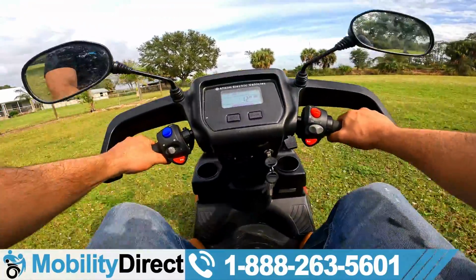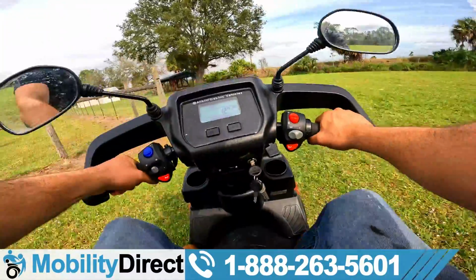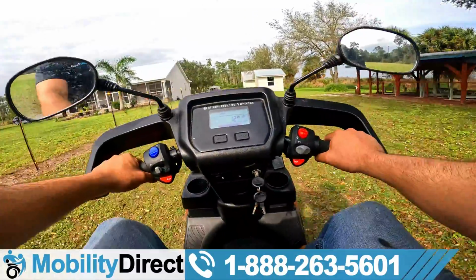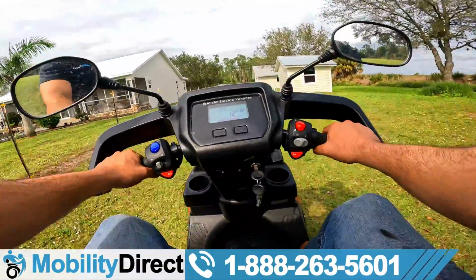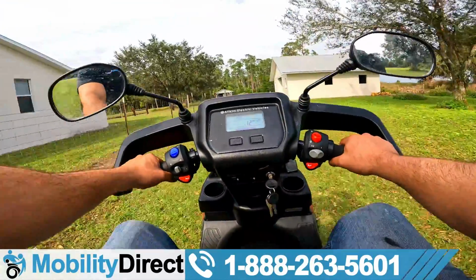All right, so we can safely say that it's working just fine now. I just hit 12 miles per hour, going over all kinds of bumps, and it's not giving me the error 1 code anymore. So we've successfully diagnosed and fixed the issue. It was just a loose connection.